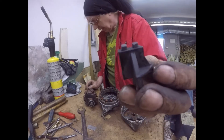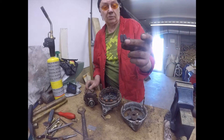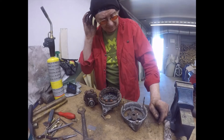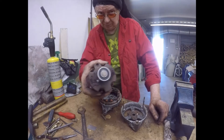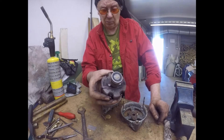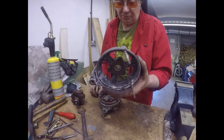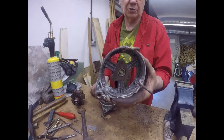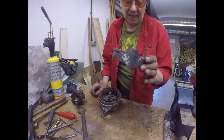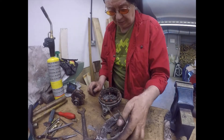The brushes aren't very high — they should be longer than that. I've probably got new carbon brushes I can put in there. I can get these bearings out. This back bearing is easier — just take the rubber seal out the back, wash it out, put some more grease in it. This one's a bit more awkward — it's riveted into the case, but I can unrivet it and put three little bolts in. It depends on whether it's worth it or what the price of a new alternator is.